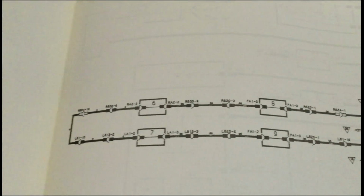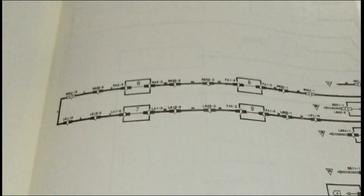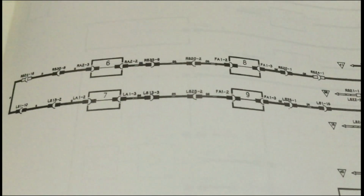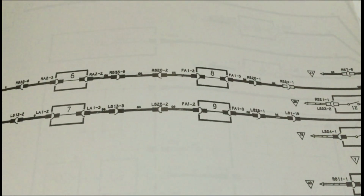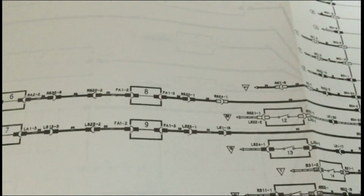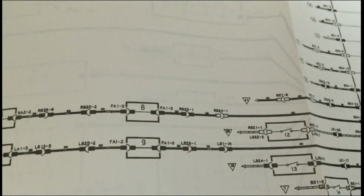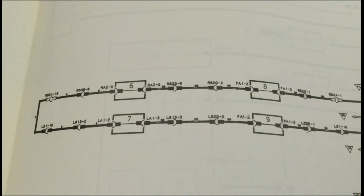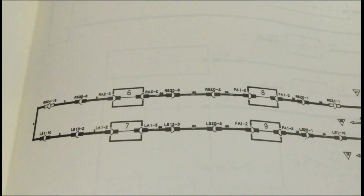Good afternoon, and I thought we would do a quick video today explaining why my XJ40 failed the MOT, and then also explaining what we had to do to get it to work again. Now, the only failure on the MOT was that the low brake pad warning on the VCM was illuminated. Last year that would have passed, it wouldn't have caused an issue because the pads are fine and it's just a warning. However, this year, since May 2018, any warnings of this nature need to be rectified, otherwise they are classed as major defects on the MOT, so in other words a fail.